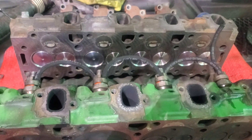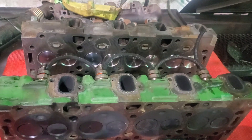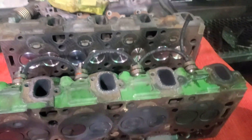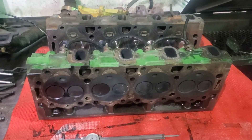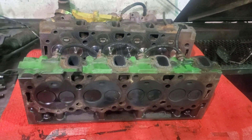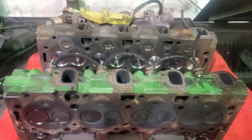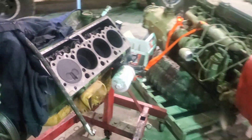Along with that S400, I'm hoping I didn't really have drive pressure issues at all this year - at about 50 pounds of boost I was right at 50 pounds of drive with the S372. So I'm hoping with the S475 and the bigger turbine I'll be able to flow enough for that big turbine and keep the drive pressure down as well, saving head gaskets and keeping her together. I've attributed a lot of my success this year with keeping the engine together to keeping drive pressure down and cylinder pressures down.